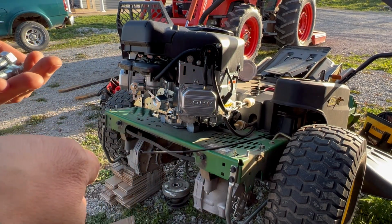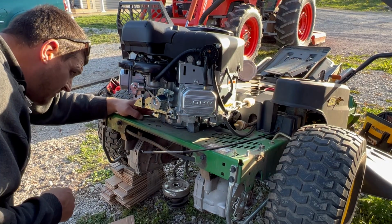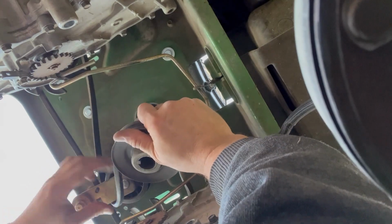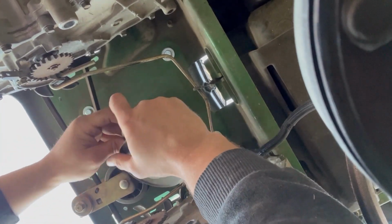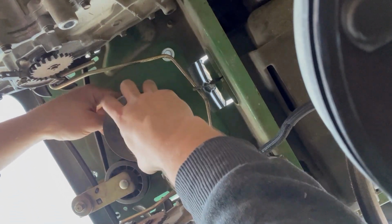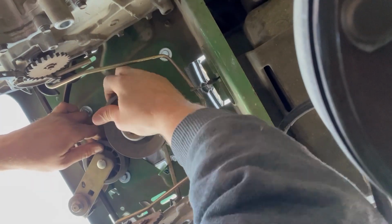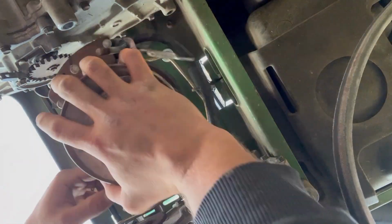But I guess I could have tapped that because the new holes were smooth bore. You just tap them in there. You live, you learn. I'm an idiot. That pulley, I think I also put on upside down initially because the whole assembly wasn't sliding back on smooth. So once I got that figured out, I was really appreciative that that keyway was welded on there, because if that was loose, that would have been a nightmare trying to handle all that.